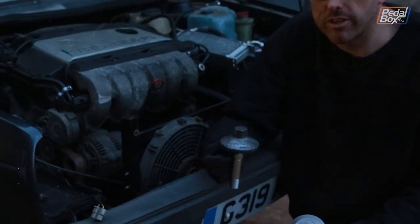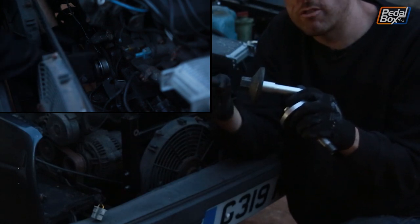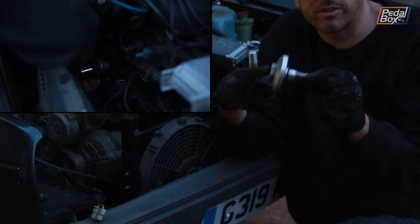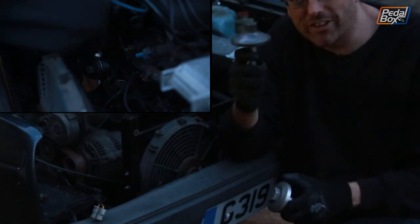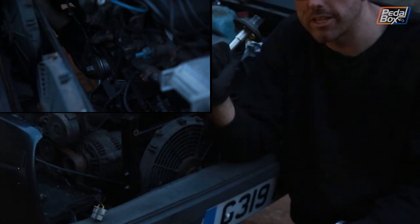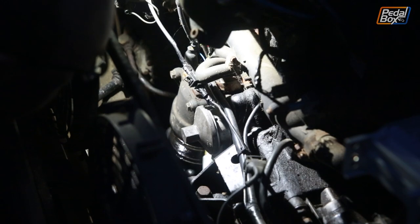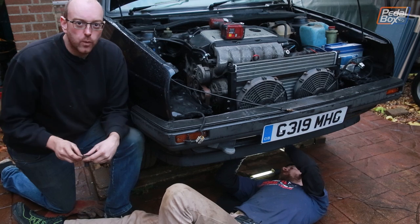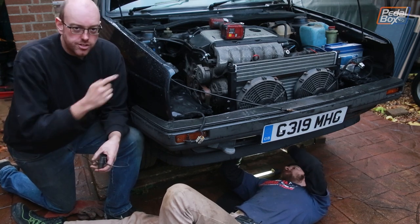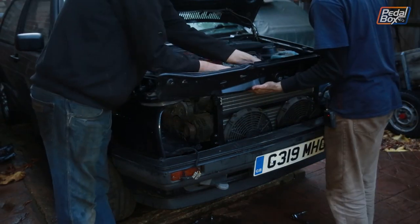While Chris firms up the welds on that sump, I'm going to put our new oil pump separator bolt back in. This goes through the center of the oil pump sandwich plate — this is the original cap off the VR6 that I took off to install the sandwich plate. This screws onto the bolt we got, and this will supply oil to both the sandwich plate and to the oil cooler which sits on the front of the block, replacing it in a single one-piece that hasn't been butchered by me. While I'm in there I'm going to put a new filter in as well. One of the main things we've been waiting for to get this through an MOT is a new crank position sensor, which I've finally got with the correct plug on. Chris has just taken the old one out and we'll swap in the new one, then button up the front end of the car.